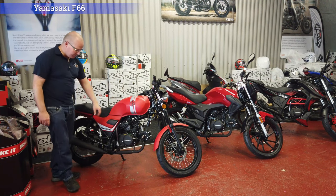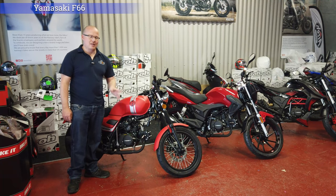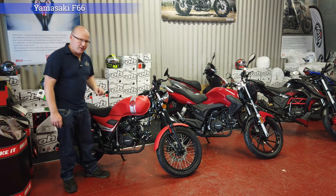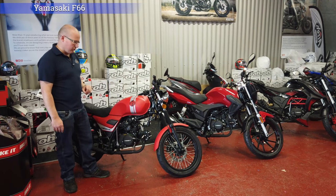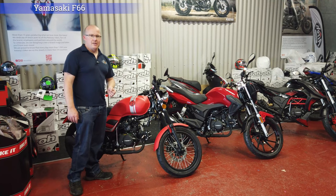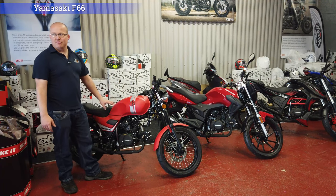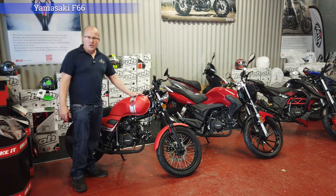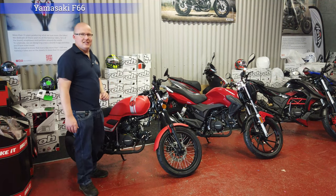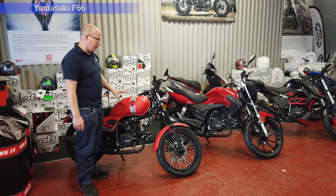It has piggyback rear shocks and it does have a kickstart, but remember if your bike has no power at all — if it hasn't got enough power to light up the dash — you still can't kickstart the bike because it won't prime the tank. You can jump it still, but if you ride your bike at least once a week for more than four miles you should never really have a problem. Euro 5 specifications state all 50cc bikes now have to be fuel injected, so all of these are.